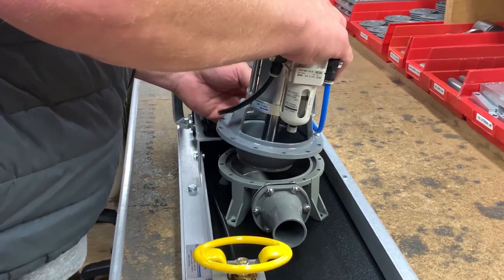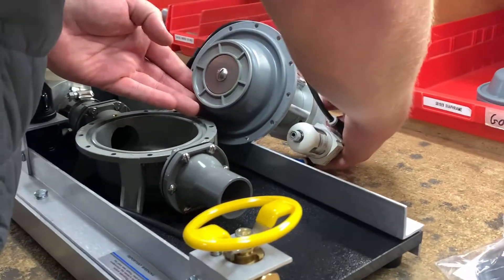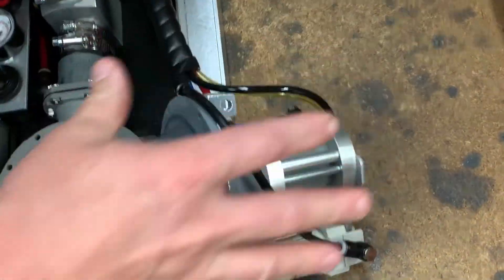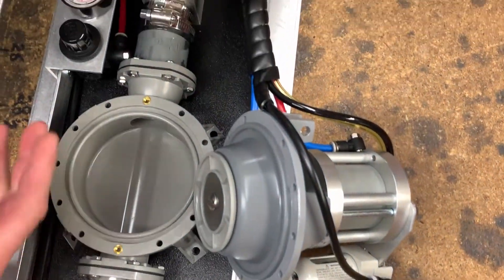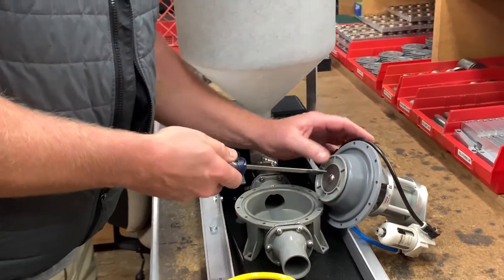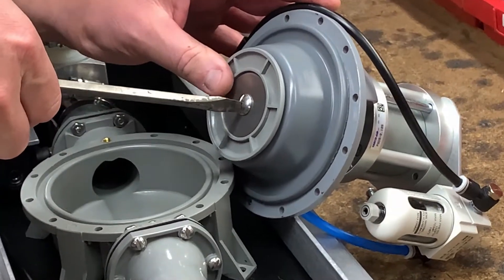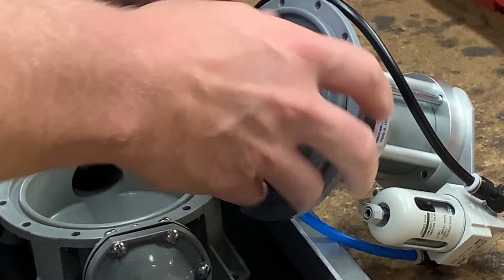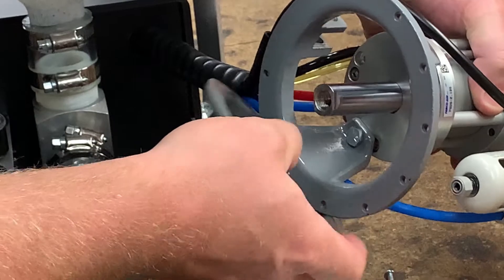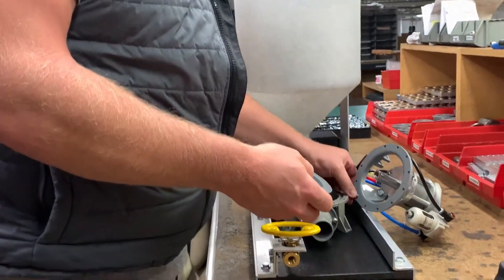For the GP3A air pump, remove your caps through your slotted-head screws, then roll it over gently. All your lines are still connected — you did not disconnect anything — so just lay that over very simply. Take your flathead screwdriver into the slotted truss-head screw, hold your pump body, and unscrew it.